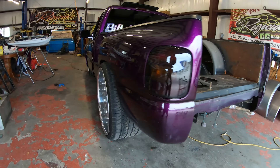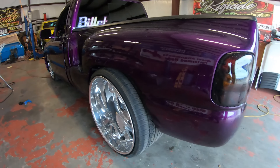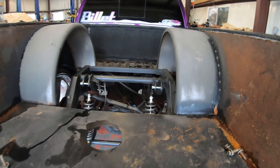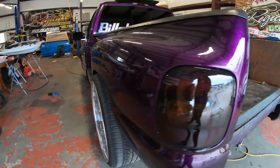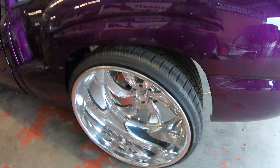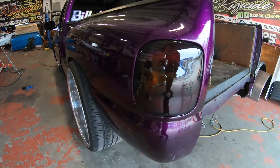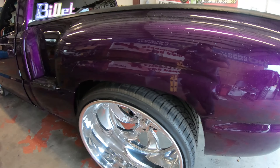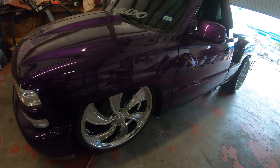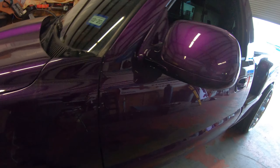This is pretty much how it ended up coming out. It sticks out — I want to say a good four inches. It's hard to tell because I still have my panhard bar connected to the suspension so it's kicking the rear end to one side. But assuming that I had a 12 inch wheel with a 10 inch lip before and I added pretty much just four inches of lip, I'm going to assume that it's four inches I need to cut off just to be in the same spot. Once I confirm the measurement, we'll pull the bed back off and take the rear end off.